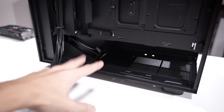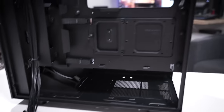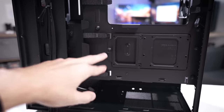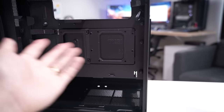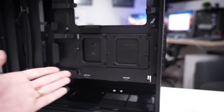As a result of this fan's location, you can't mount a 3.5-inch hard drive down in the basement — that cage no longer exists because the fan is there. What you can do instead is mount a single 3.5-inch drive here, and then mount a 2.5-inch drive next to it. You could stick 2.5-inch drives pretty much anywhere, but the 3.5-inch is most important since spinning platters need to be stationary — at least you get one place to mount that drive.